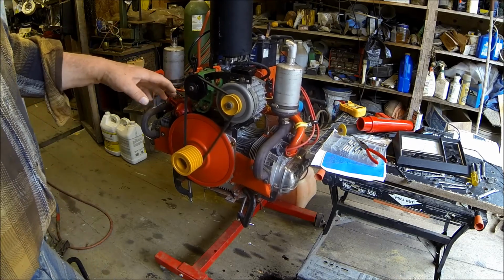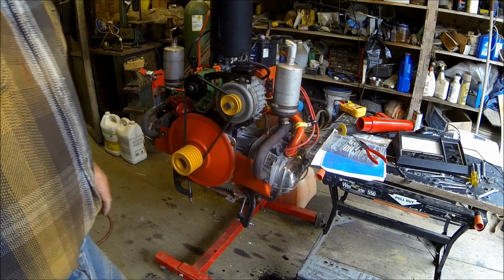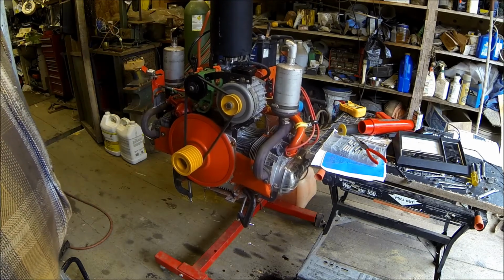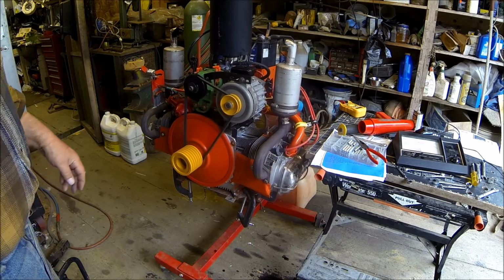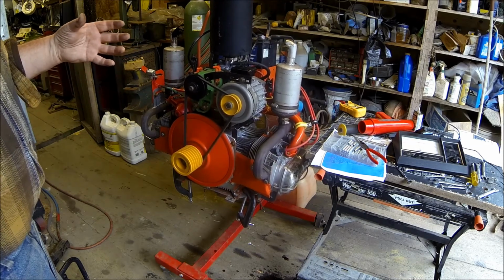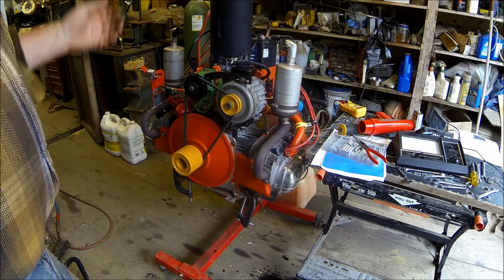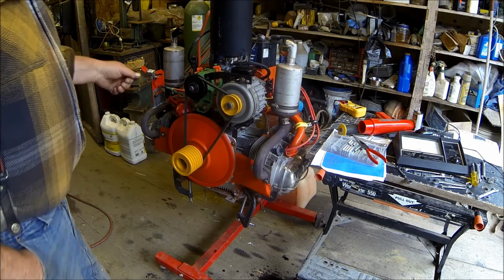I went through all of that today. I hooked up my engine analyzer to it and set the RPM up, and then put a timing light on it and adjusted the timing. I'd statically set the timing for top dead center when I put everything together, and that's exactly where it was at with the timing light. I had to adjust it a little bit. It's supposed to be 14 degrees. And then I checked to see the advance on it. When you run the RPM up, the advance goes just the way it's supposed to, so that's working good. The governor is set up.